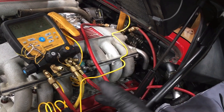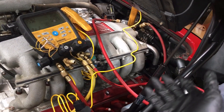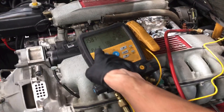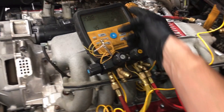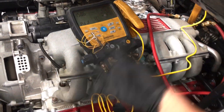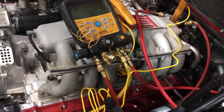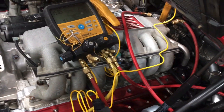So I said I'm going to try this under pressure — put pressure in, it passes the pressure test, fill it up, and we have a good running system. Other than me hooking my gauges up backwards — my high was on the low and my low was on the high — hey, stuff happens. But with digital gauges you don't have to worry; you're not going to break your low side gauge.